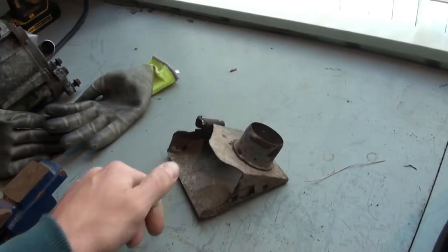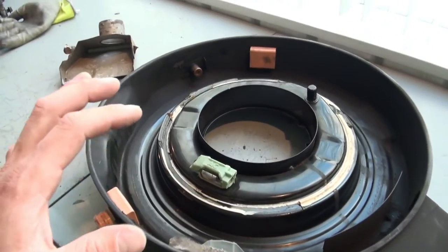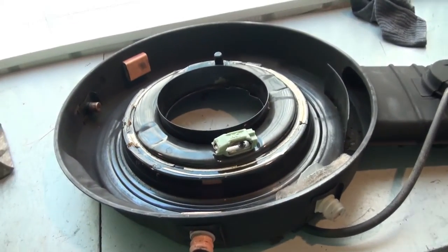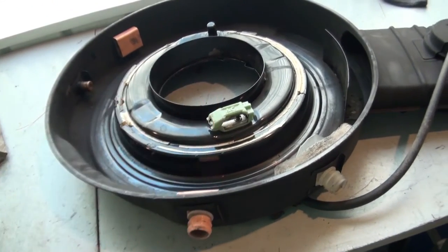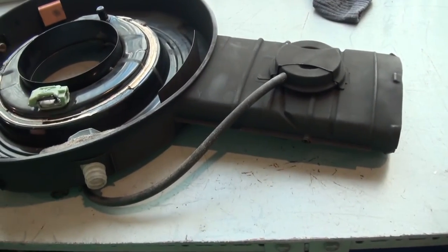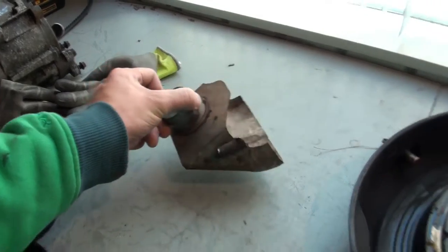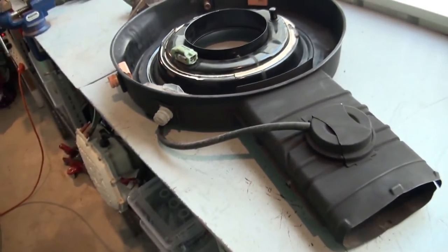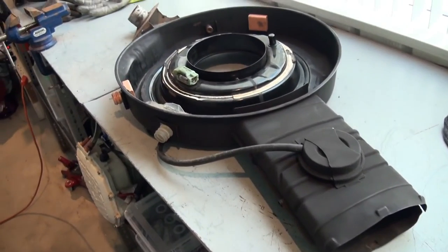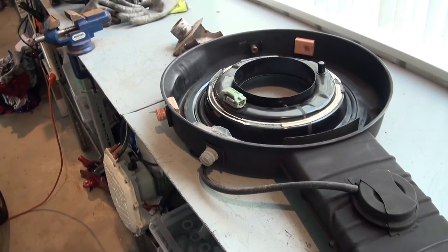I doubt I'm going to be able to utilize that in my motorhome — I'm going to have to figure out a way to reattach this. If you understand the general concept behind the operation of this and what it's trying to do, you should be able to diagnose most problems. Sometimes this little temperature sensor can malfunction. Sometimes a sticky vacuum motor can cause issues, or maybe you've got a break in the vacuum line. Perhaps, like me, you've got a heat stove that has just fallen right off. What you'll notice is that when you start your vehicle — your 80s or 90s Camaro or motorhome, whatever GM vehicle you have — the choke stays on for quite a long time before you can kick it off. That is one of the symptoms that can happen.